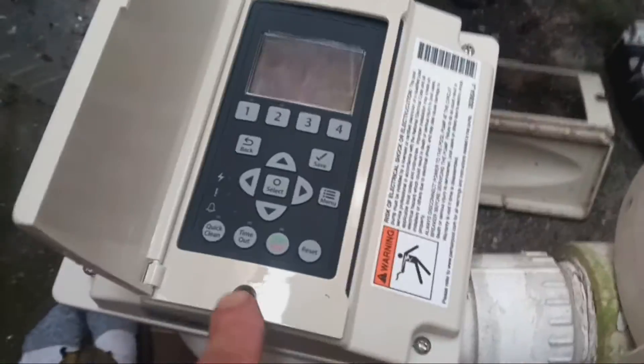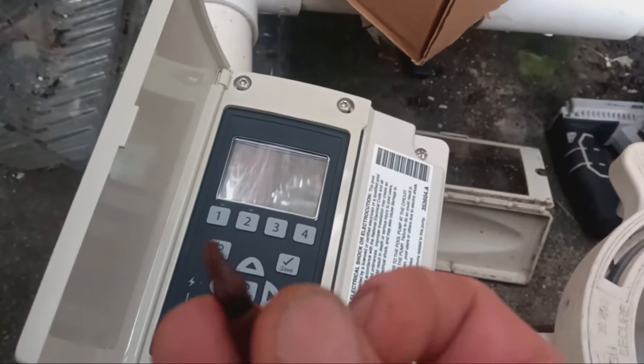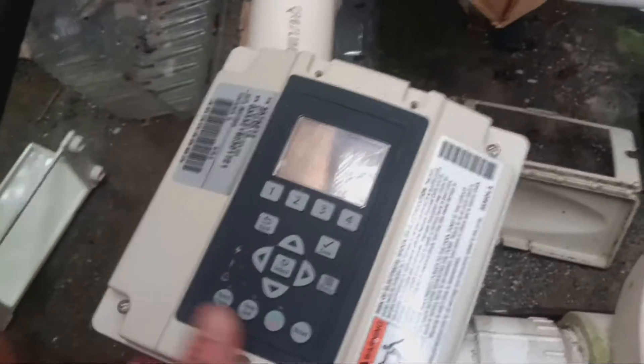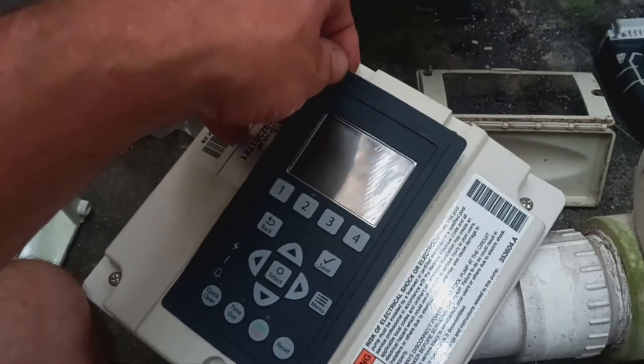I'm left with just the screen and the controller backing — about the size of a cell phone. On this one there are three screws: the original had three long Phillips screws that held the drive to the motor, but these three are shorter and are small Torx screws. We take the Torx bit and remove those three screws. This piece just lifts off now. I've already disconnected the connector — just undid the two screws and pulled it out because we don't need it; we're going to use the old one. We're pretty much loose and just have to peel this off and lift it out — there's some glue around the outer edges, and that's okay.